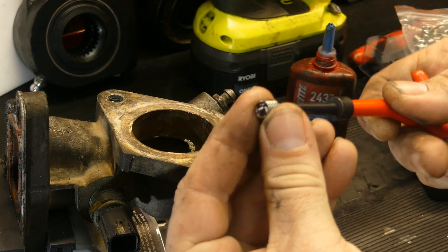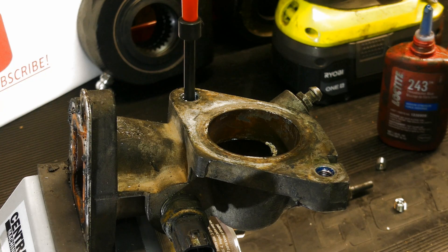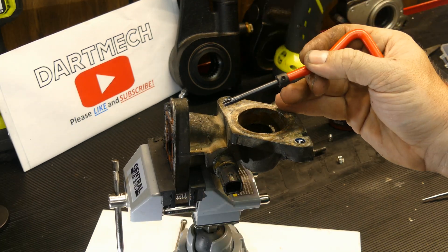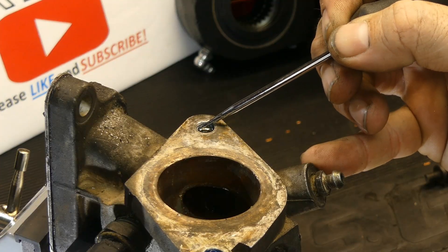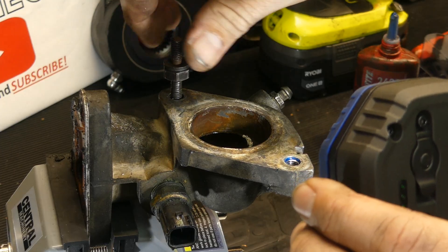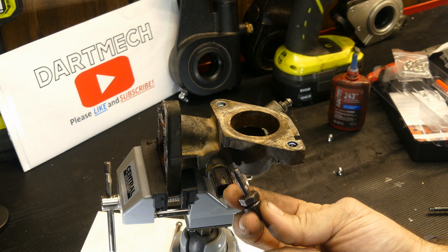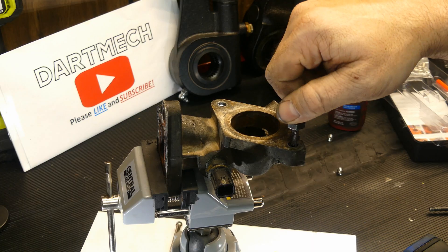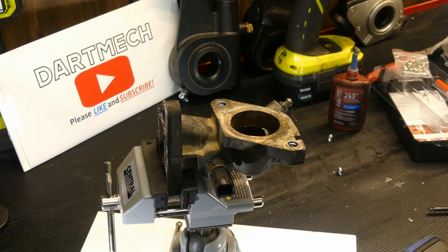Do the same thing for the other side — put the insert onto the tool, a little glob of Loctite, get it lined up. I'm going to run this one all the way to the bottom as far as I can, because I don't want the threads of the bolt to hit the tab at the end and end up warping it. Sometimes these tools get boogered up — this one's brand new and already has a bunch of scratches on it, so go easy with it. You can see that the threads here are pretty close to the top, and those start further down, just so the threads of the new bolt don't go bashing into it. I always suggest testing your fit — that looks pretty good. I want the Loctite to set, so I'm just going to test-fit the threads. I posted a short about this and a lot of people said just use a nut and bolt, but you can't do that here because it's in the water jacket, plus this bolt has threads on both sides — you lock the thermostat housing down and then put the AC line on top of it.